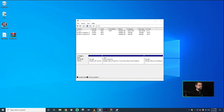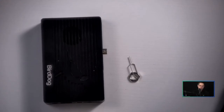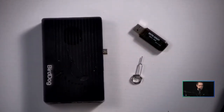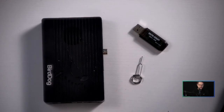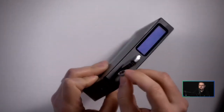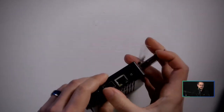Now we can remove the drive from the computer and bring the unit over. I've got my unit, a little pin for the factory reset, and the USB drive. You'll also need power — PoE is readily available in my office so we'll use that today. Plug the USB into the front of the unit. Take your pin and insert it into the factory reset button — you'll feel it click just a little bit. It's a very light touch — no need to force it. Just go gentle and push that pin in.